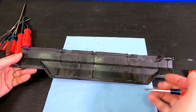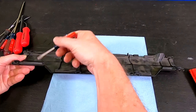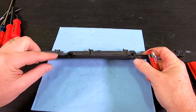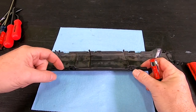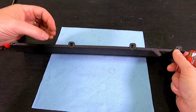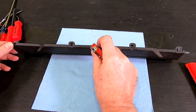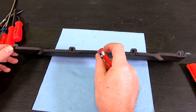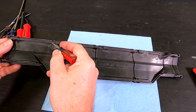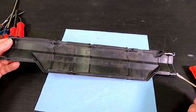Also important to note: all along the perimeter is a slot, and the back cover that this connects to fits into this slot. So even once you pull the tabs up, there's a natural friction that holds the cover in place. It's going to take some effort to pull it back once you have the tabs popped up. That slot goes all the way along the bottom and all along the straight sections on the top as well.